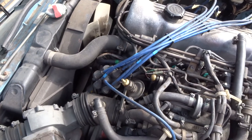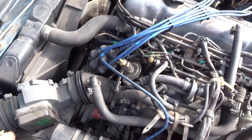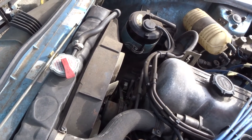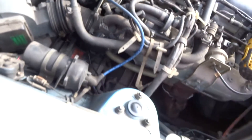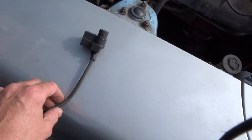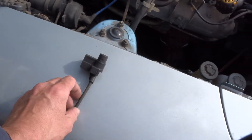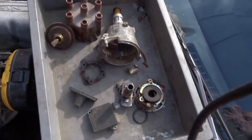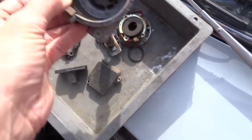What we're doing today is the cam pickup, which works on the distributor on this vehicle. It doesn't have a cam pickup - it's chain driven, not a cam belt, so it's hard to get in there to put a cam sensor in, so we're going to use the distributor to get the cam sensor. We're going to use what they call an inductive pulse - we've got this here, it's a Vauxhall inductive pulse. I've got the wiring loom and I'm going to use this to set up where the engine can tell where the firing order is and what cylinder it's firing on.